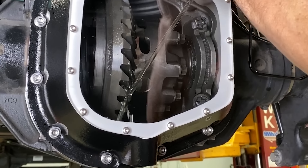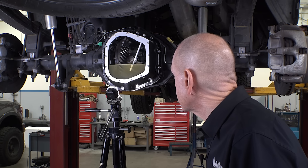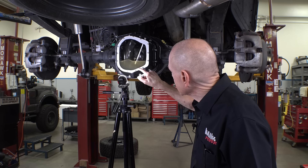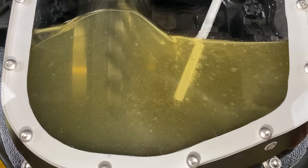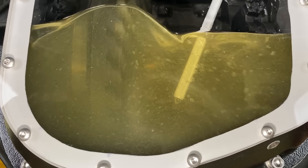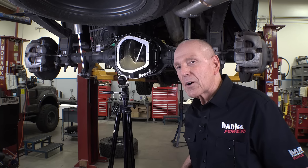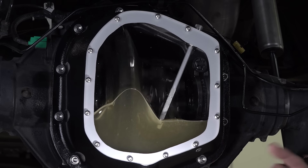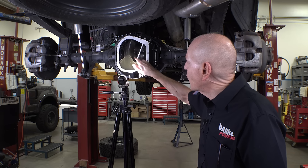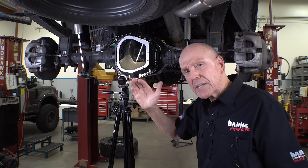The Mag Hitek is on the truck. Let's see what's going on inside the cover. All right Curtis, go ahead and idle it. I can already see aeration forming in here and we're just at idle. The thing you don't want to do is add unnecessary work to the fluid — it aerates it and it heats it. So here we are at five miles an hour. We're already pushing the lube up and it's falling off to the sides. Nothing is being taken to the pinion area.